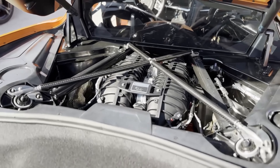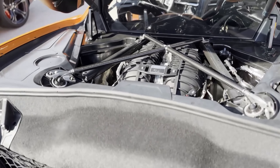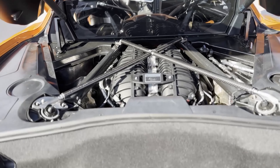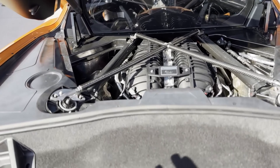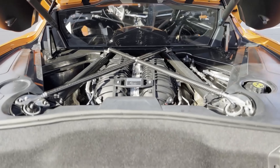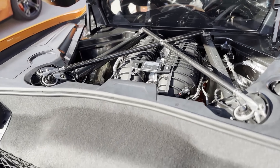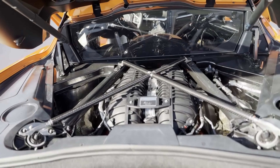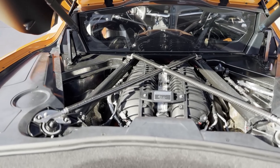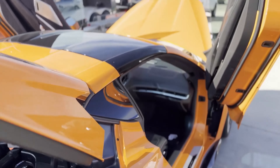They were gracious enough to say, hey, test this thing out, see what it does. The whole point of throwing this cross brace on the car is it basically connects those corners, as you can see. By connecting the corners, it gets rid of this big open space that you have in the center of the car, or in the engine bay here. Anytime you have big open spaces like that, it'll make the car not as rigid, so it helps bring the rigidity of the car up. We'll find out once I get on the track and start testing it. I'm looking forward to doing this in the C8 Z06 today.